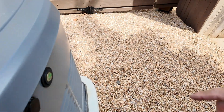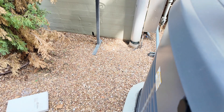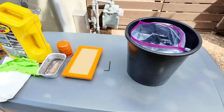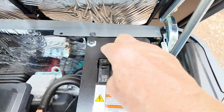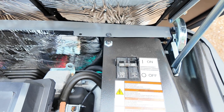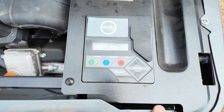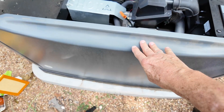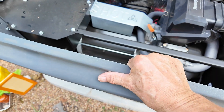You're going to have to unlock your generator — there are two locks, one on each side. Once you open the top, the first thing to do is turn off the circuit breaker. Here's your main circuit breaker — turn that off. Then go over and turn your control panel to off; confirm it does say switch to off. You'll also want to take off the front panel — just lift it up from the middle, rotate it out, and set it aside.